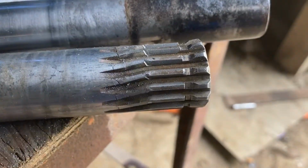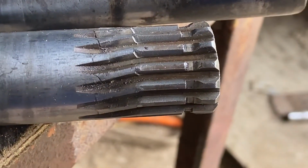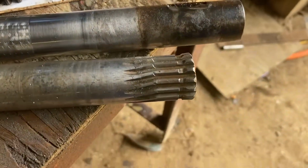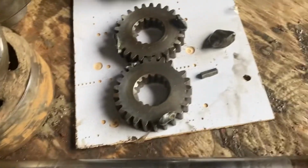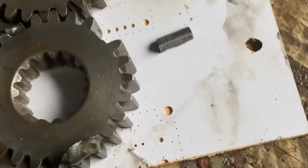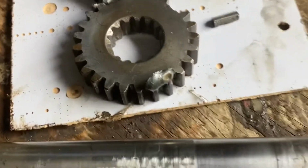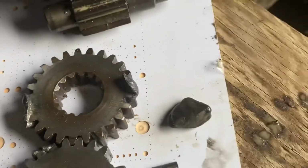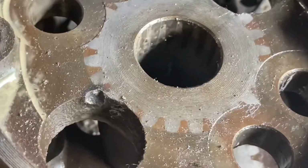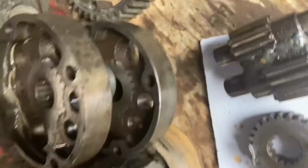One thing was the axle. Very twisted, cracked, beat up. The reason that is like that is because that is the axle with the second damage report. It is that axle gear there with the chipped tooth. It had that slop in it, and that slop caused a twisted axle that's cracked, and it caused some welds snapping from the actual diff itself, the housing on each side there.